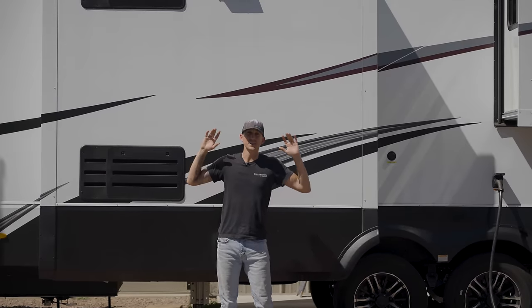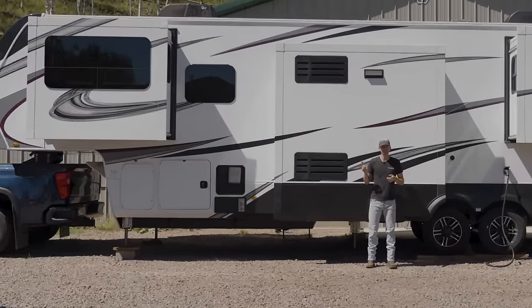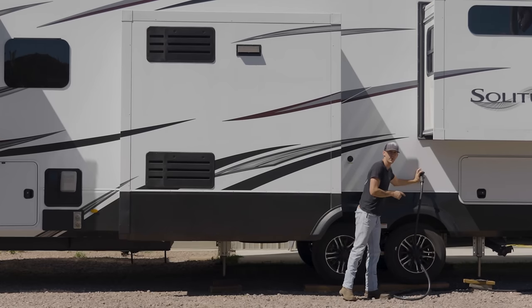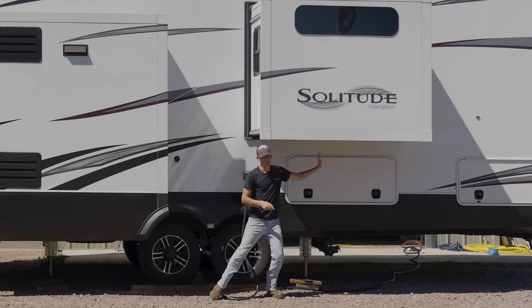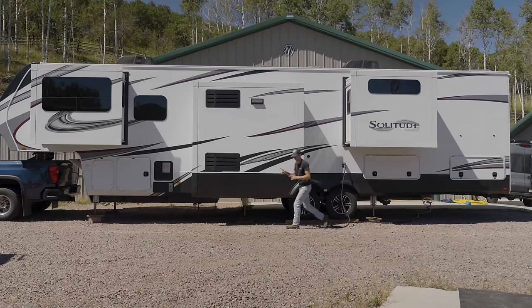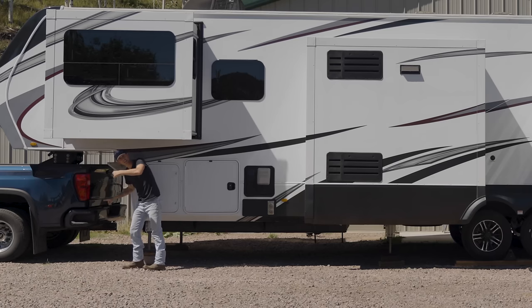This camper is absolutely massive - just a shade over 42 feet long from tip to tail, and it can be kind of overwhelming electrically to figure out where to start. On this side of the camper there are realistically only two spots we need to look at: first is the shore power inlet, where power comes in from a shore power pedestal at a campground or house. Behind that there is nothing we need to worry about from an electrical point of view, but we do need to look up here underneath the front of the camper behind the bed of the truck.